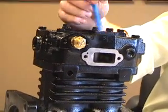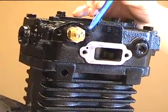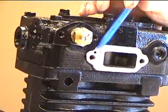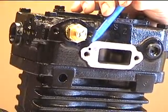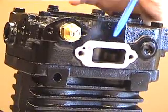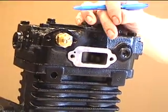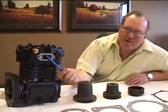The last thing to consider is the intake. Most compressors today are turbocharged, and the turbocharged air is clean because it's tied directly into the compression side of your turbocharger. You get a new gasket to seal this area with your compressor, so make sure the intake surface is clean. The hose running from the airline box should also be in good condition — sometimes those hoses get so soft and pliable that they collapse when boost pressure comes on, effectively sucking closed.